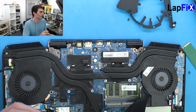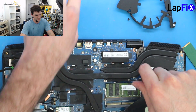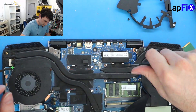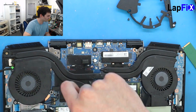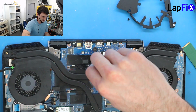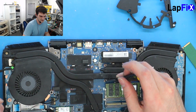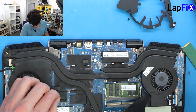Just go until you feel it tighten. Once it tightens, it should be very straightforward — you shouldn't have to do anything more difficult. Once I feel it stop, I'm done, because you don't want to strip that. If you strip it and ever have to take it off, you're going to have a lot of trouble. What I like to do is just go around and do a little bit of a tighten on each side. Make sure it's totally tightened up, because you want it as flat as you can. If it's not touching a little bit, you'll probably get a blue screen or your computer will shut off a lot because it's getting too hot, especially if you're playing games. So before I forget, let's connect the fans.